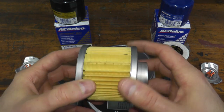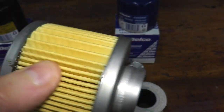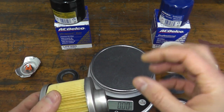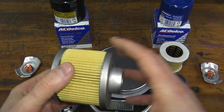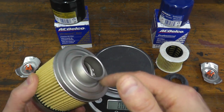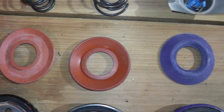Now let's talk about the media. It's nicely made — the spacing is quite good. You find a little bit of overspray, but you're nitpicking at that point. Metal end caps and a metal center tube, which many of you like to see. Regarding the efficiency and micron rating, this filter can capture particles between 25 and 30 microns at a 98% success rate. To put that in context, the thickness of a human hair is roughly 70 microns — so these are very, very small particles. At less than $7, very good numbers. It is not wire-backed; if you want wire-backing, which keeps the rigidity of the filter over time, you need Wix XP or Royal Purple.